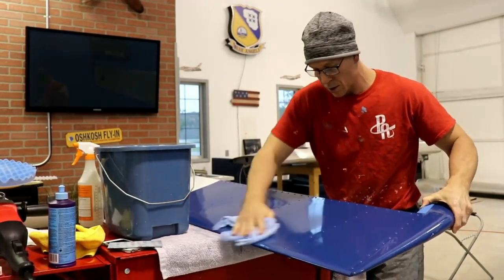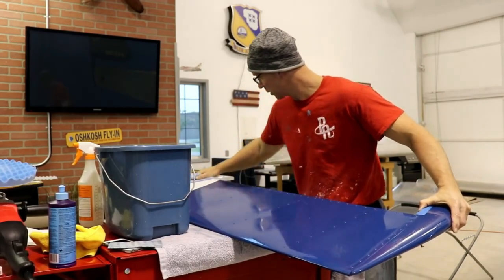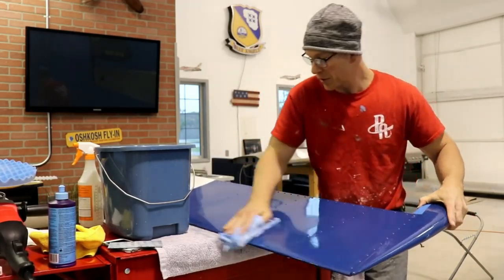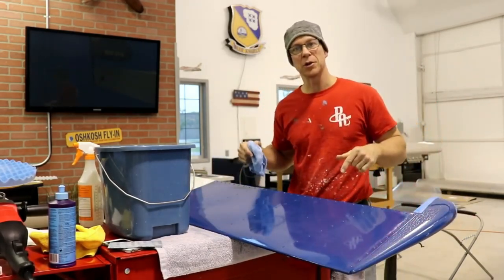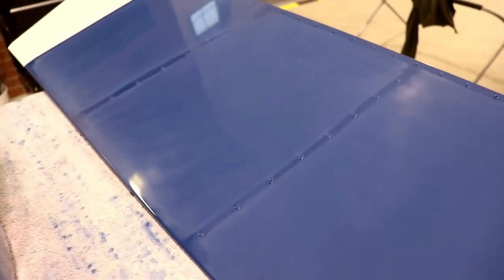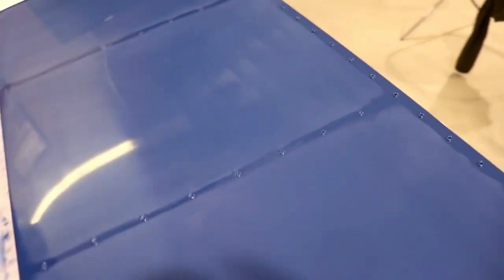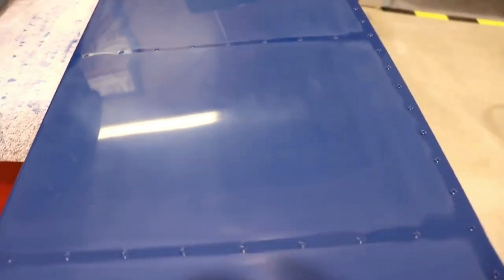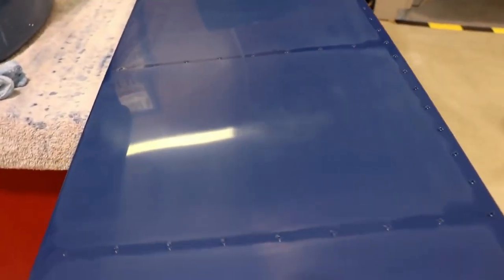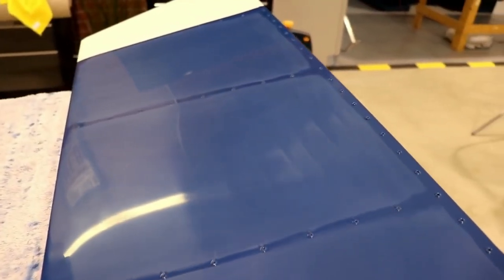When you're done with the 3000 and 5000, take a rag with clean water and wipe it off really well, then make sure it's completely dry before the next step. Here's what it looks like after the 5000 grit sanding — the sanding part is all done. It's looking really good: obviously it's dull, but it's really flat, no orange peel. Another advantage of doing this is any dust in the paint is completely gone.